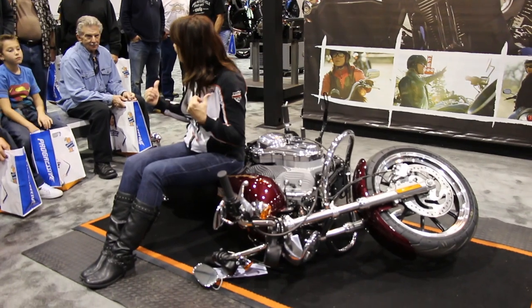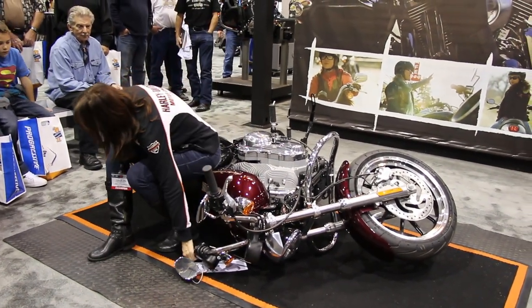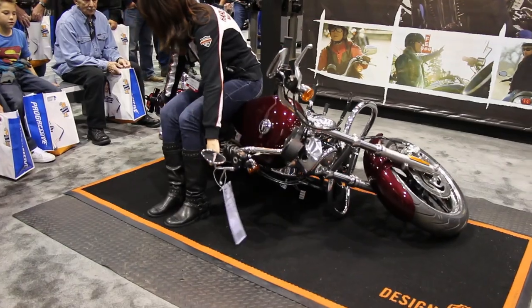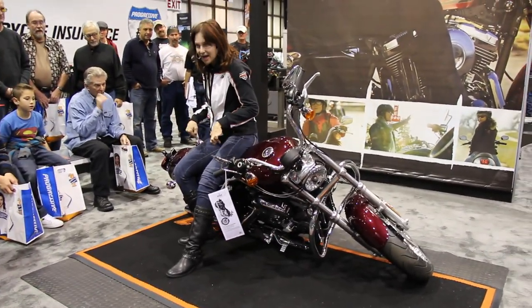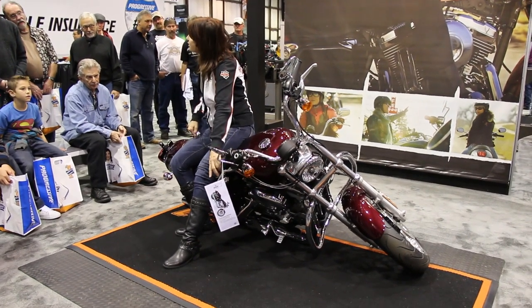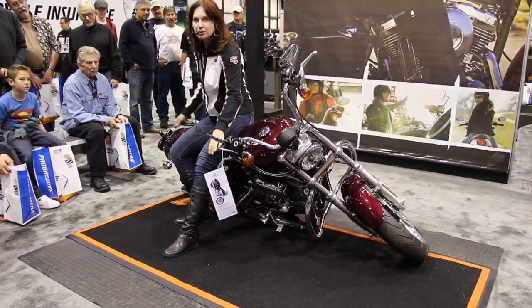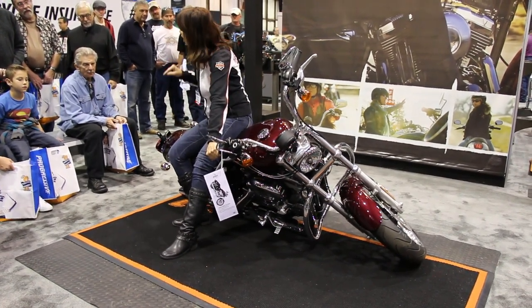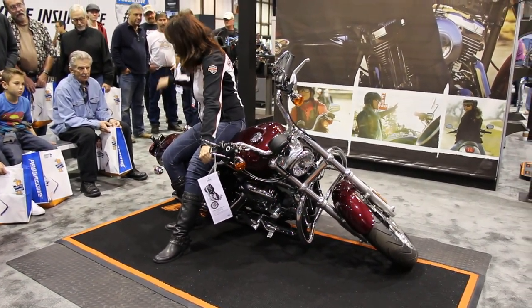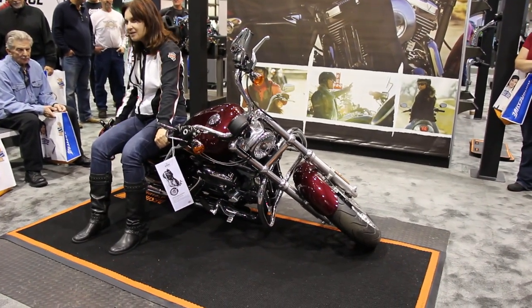At this point, I'm going to rock the bike back and lift it up to a 45-degree angle and then stop. The key with this bike and any bike is to make sure you stay on the seat so your legs are doing the work and not your body. For an Ultra Classic or larger bike, this is the angle of the bike when it goes down. The key at 45 degrees is to drop down low in the seat — now you can use those leg muscles.